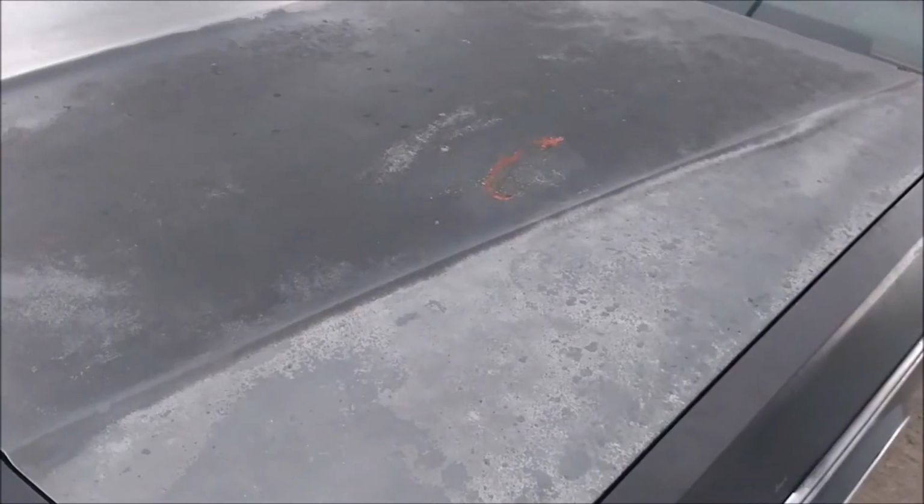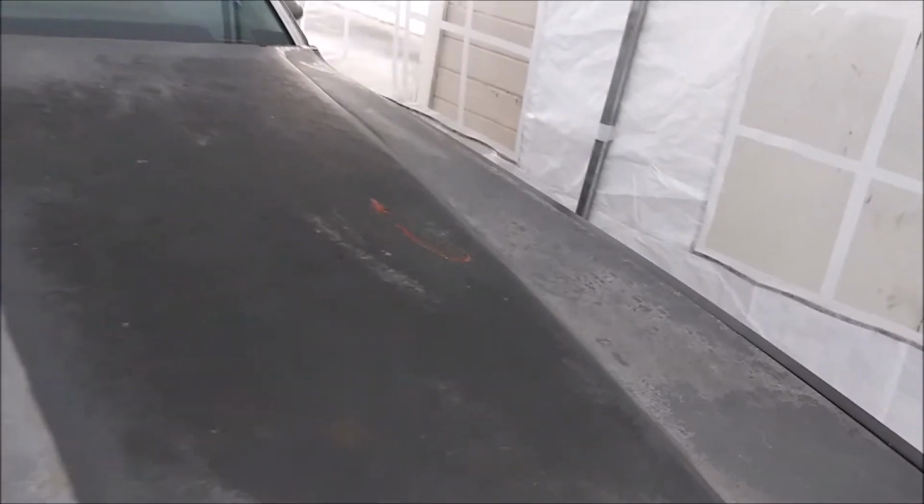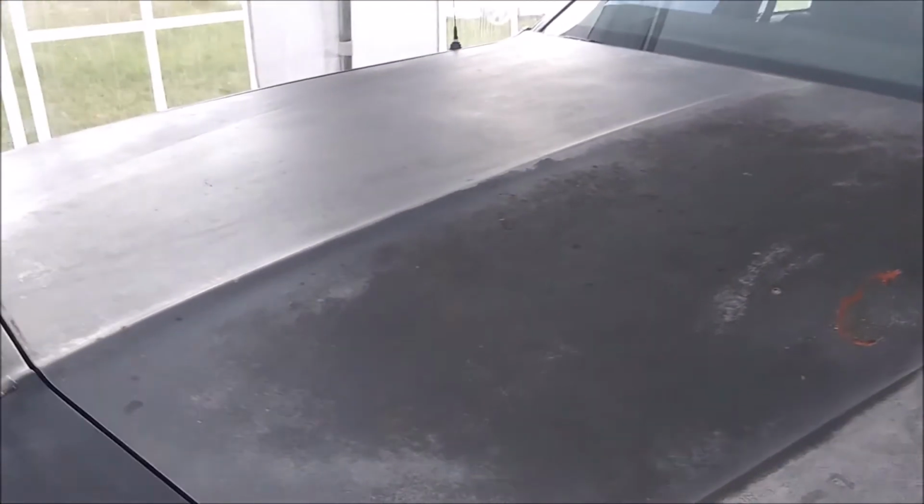But the thing about doing that, I don't know if this is a 2-bolt main or 4-bolt main. Now with the power target I want, which is about 360-ish maybe, a 2-bolt main would be fine for that. And I don't want to rev this out to 9,000 RPM either. But if it's a 4-bolt main, it'd be better. More than likely, it's gonna be a 2-bolt main though. I'm actually pretty sure it's a 2-bolt main. But if I could get a 350 that is already a full 4-bolt main, that'd be better. I at least want a short block, and then put my own heads, my own intake, stuff like that on there.